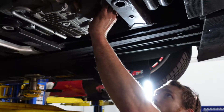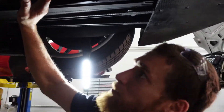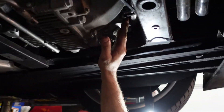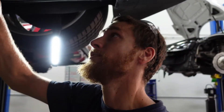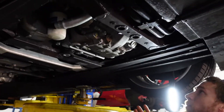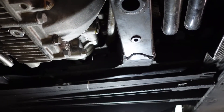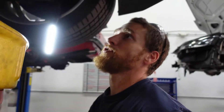We start to drain the rear differential here — just a mechanical device. Always, before you drain the fluid on differentials, loosen up and take off the filler plug first to make sure you will be able to access it. Otherwise, you can drain the fluid, have a problem on the filler, and not be able to refill the car. The fluid is very hot. See? That means we are on level — we are pretty much good.